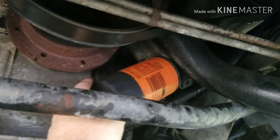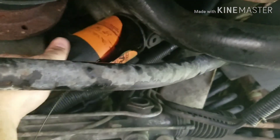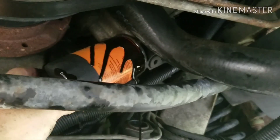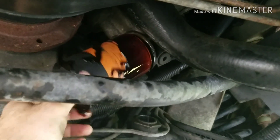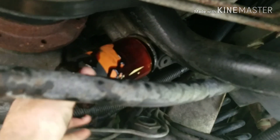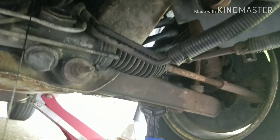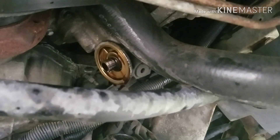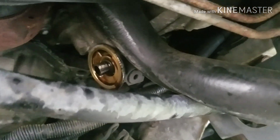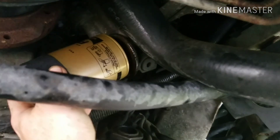The oil pan is right over there — this is the oil filter, it's normally right underneath the motor. It's going to drain a little bit, so make sure you have your drain pan underneath here. You might get a little messy. Just make sure you undo it — you're going to let the filter fall into the pan. Now that the oil filter is off and done draining, go ahead and screw the new one on.